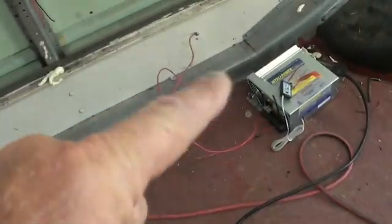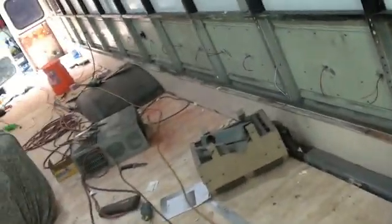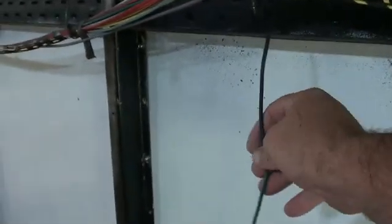So I'm running my generator, and I got that plugged up. It'll actually be the 12 volts that runs all the lights. If my generator's running, it'll run all the lights, all the 12 volt accessories in the bus. That's what that does. And this is my wire, which used to be for all the marker lights before, and that's what it's going to be for now. You pull a switch and every marker light on this truck will power up.